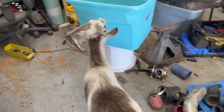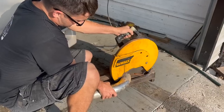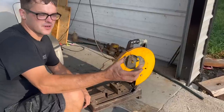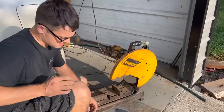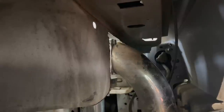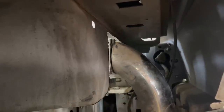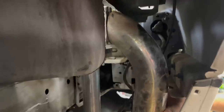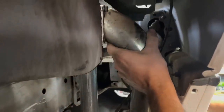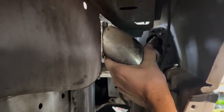Now it's old truck running boards is all it is. So we cut our piece of truck running board at an angle there, and I think this is going to fit. I'll probably have to go back and pie cut it down here somewhere to get the angle a little bit steeper, but I don't think I can do it here without making this flange too long. So I'm going to tack it to our exhaust flange here and we can weld this up.